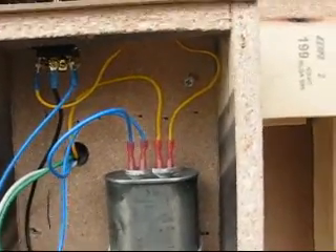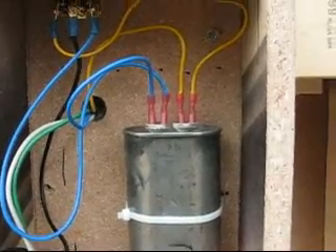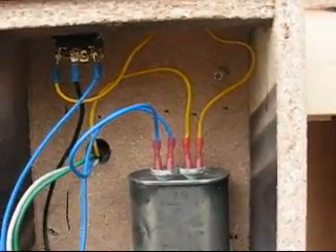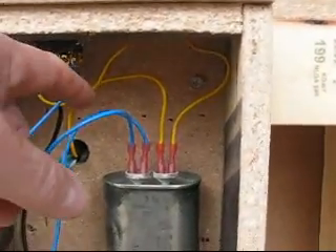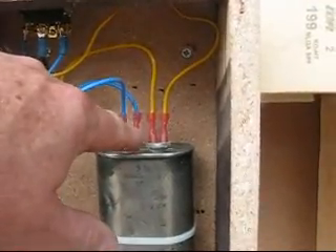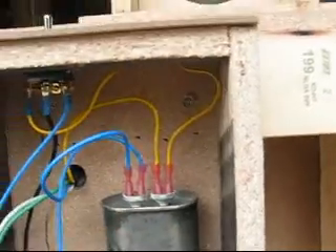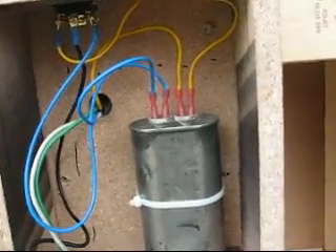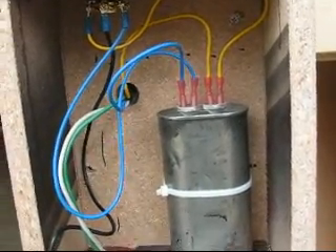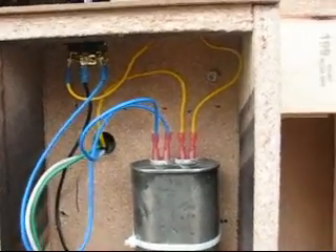Now for the capacitor wiring — there's two ways to do it. You can do it this way, which I thought was the easiest because trying to put both wires on one of these little terminals can be tough to get crimped right. Some setups have the blue come into one terminal and back out the same one with no separate plug, same for the yellow. That's perfectly fine too, but this is just easier. That's basically how I wired it — it's unplugged so I'm not worried about getting shocked.